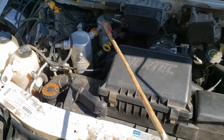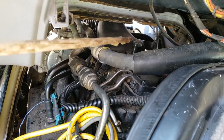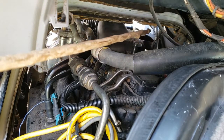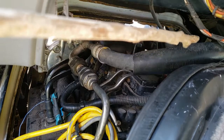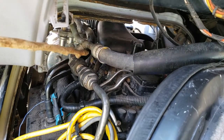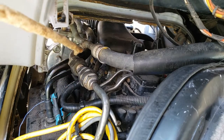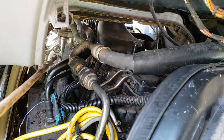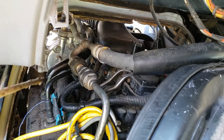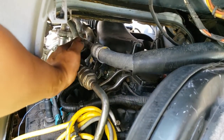This tank-looking thing is just part of the hose. Here's a view from the back of the engine with the doghouse partially off. There you can see the small tank-looking thing that's part of the hose. The hose wraps around and connects with the rear AC, going into the suction manifold that connects on top of the compressor. If your AC is working properly, you should touch the suction manifold and it should be cold.